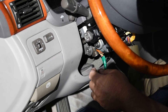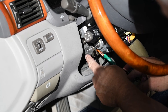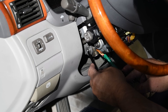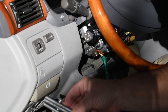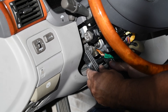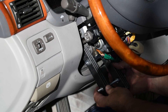This is the pivot pin here that holds the nut that the tilt motor screws into. This was the part I replaced, and in the process of removing this nut, this little bolt right here I had to push back in. The problem was there's no good way to get enough force to push it in directly because the angle was not right to pound it in. So this is the tool I invented — it's kind of like a vise. It has some strong metal plates and a couple bolts. I put the thing here just the right size, got it in on both sides, and tightened down this nut with a wrench, which squeezed it together and pushed both pins in together. That was the only way I could find to push those two pins in effectively.